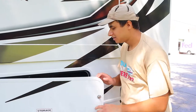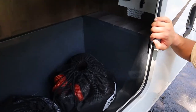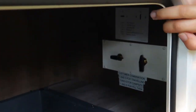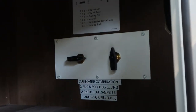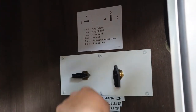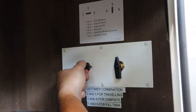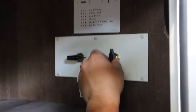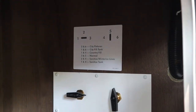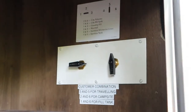In the back of the driver's side here you have a big storage compartment. Over here you have a bunch of valves for the water system on this Jayco. It looks kind of complicated but it really isn't — you only have three settings you have to worry about. You have two valves here. This one can go between one, two, and three depending on where you turn it, and the second one will go four, five, and six. Right now it's set to three and this one is set to five — this is going to be normal, meaning when you're on the road and just want to use the sink or the shower, you'll have it on this setting and can take water from any of the faucets.